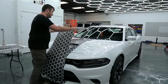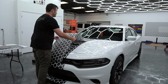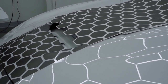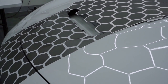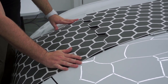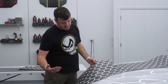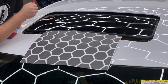After starting the installation that way, Jose did bring up something. If you have enough stripes — which you will if you buy a standard or large vehicle stripe kit — you can actually attempt to do this hood where the keyed portion of the vinyl comes to right here, then you take another stripe section and key it right there. That would help you eliminate all the stretch we just had to deal with. It would just use more material since you're dropping the stripe by half, but you can key those two areas and make it just as long.